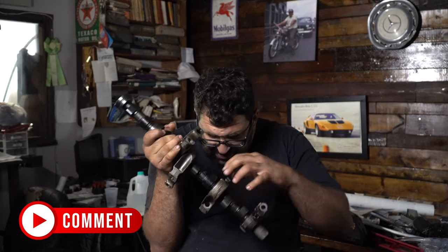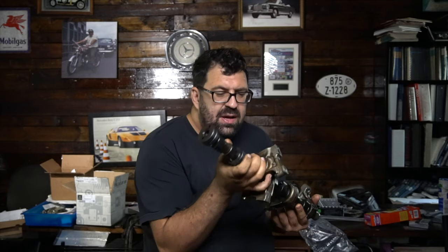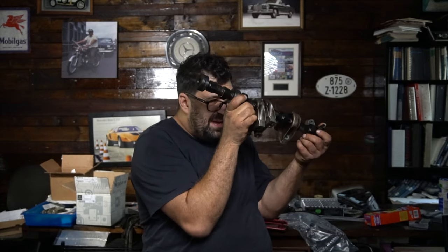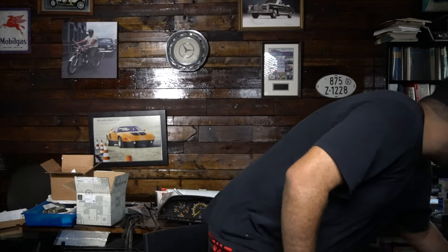You start getting up here at the front and you can tell right here that some scoring or some damage occurred. That is what we call a minor cam failure event — it just means that the oiler tube came loose because those little plastic clips became unsecured. This is a very preventable repair.